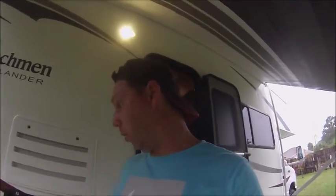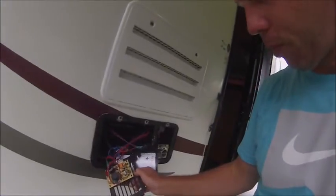The first thing I did was check to see if I had 12 volt down here, which I did. I'm getting 12 volt to the furnace. Secondly, I took the two wires that run down from the thermostat to the system — mine's only a two-wire, yours might be more. I crossed those two wires, which basically hot-wired the fan motor to come on, which it did. The fan motor came on as soon as I crossed the two blue thermostat wires together.